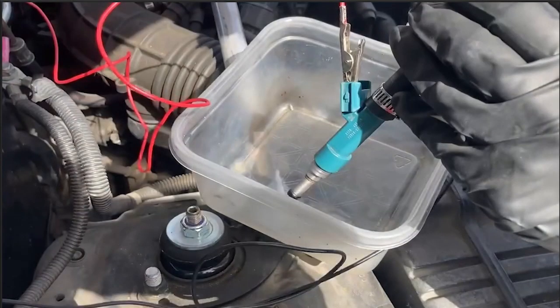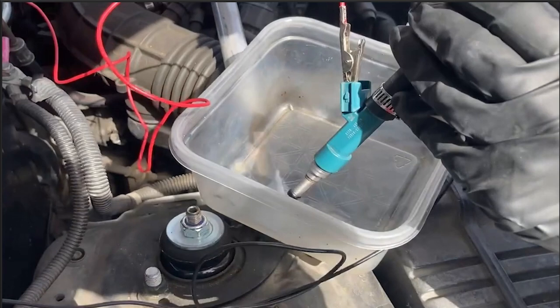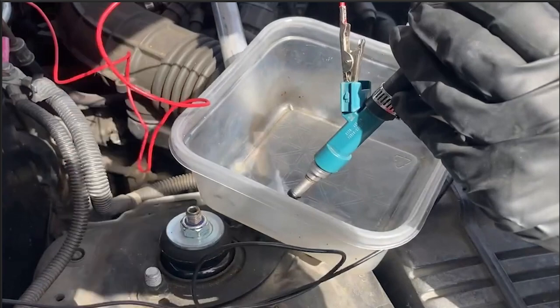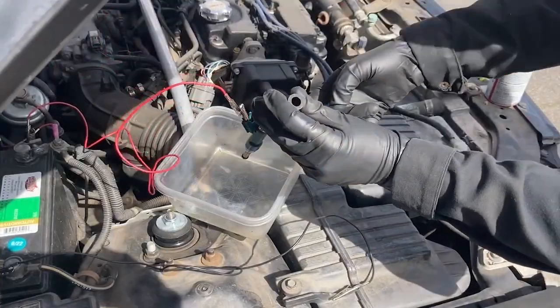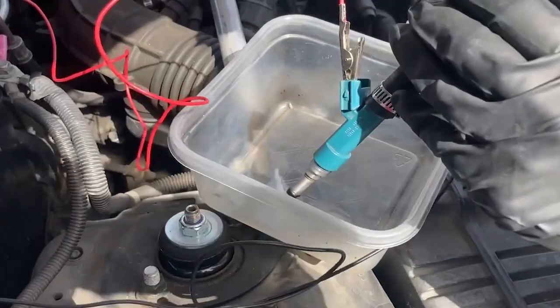This is my setup. I took a couple of inches of fuel hose — or you could also use heater hose — and a hose clamp, and attached it to the end of the injector. I attached one alligator clamp from the battery positive and one from battery negative. With power on, I closed the circuit with the negative in order to open the injector while creating pressure by blowing into the end of the heater hose. I suggest only using carb cleaner and filling the fuel hose with an ample amount before you start blowing, so you can see the stream coming out the bottom — all I'm doing is creating pressure.